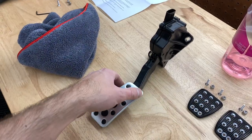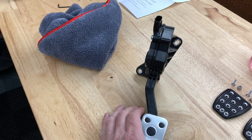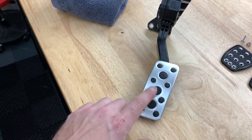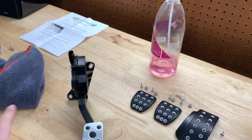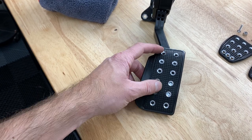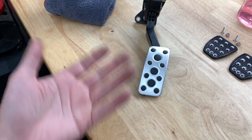The throttle pedal is out of the car. You can see the two bolt holes — one right there and one on the top right, both 10 millimeter. This one is slotted so you can kind of position it a little bit more. Let's go ahead and clean up this pedal first — just using some Gyeon Prep and wiping it down. Then you can place the cover right on here and use some self-taps, probably doing the top four holes since it lines up with those as well.